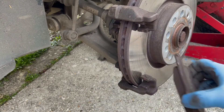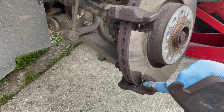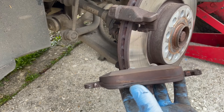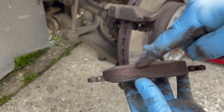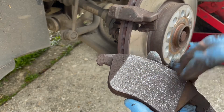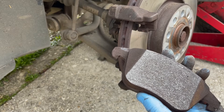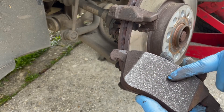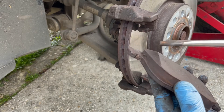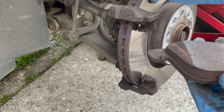These areas here are where the brake pad itself slides in and out of the carrier contacts at the top and bottom — these are the areas we want to make sure are all nice and clean. As a general health check, we can see there's absolutely loads of friction material left on the front of this pad. On a brake that's squeaking, dirt and debris from different road surfaces builds up on the pad surface over time. We want to take a piece of scotch brite, emery paper, or a wire brush to rough up that surface and take the shine off it.